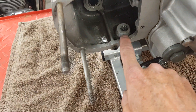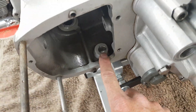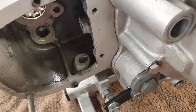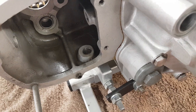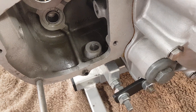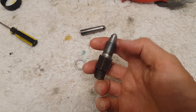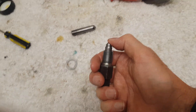That's where it screws in — this is the plunger housing, so it screws up from underneath. We'll have the plunger sticking up there, and this boss here is where the cam plate goes. I'm putting the cam plate in now, and the reason I'm doing this is we're then going to turn the cam plate round a few times and just check that everything's smooth. If the cam plate is smooth, we should have a nice smooth gearbox. The first thing I've done is to put the plunger in with the spring and just make sure it's got a nice smooth action.